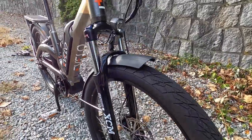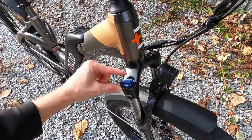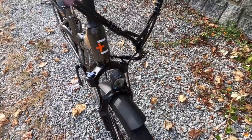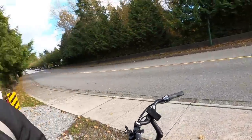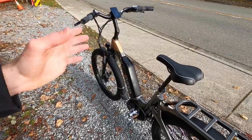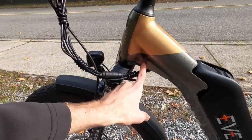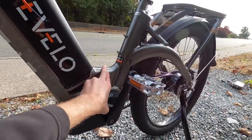Now, this thing isn't top of the line — it's still a spring fork. It's got kind of a hydraulic lockout system here for compression. It doesn't actually click; it's just a slider. Over here we have preload adjust. You can preload that spring if you're someone who weighs a little bit more. This bike does support riders up to 350 pounds. I am only 135 pounds myself, but that's pretty impressive for a wave-like deep step-through frame. They've really reinforced this — you can see a gusset right here, extra plating right there in the motor interface, another big gusset right there.